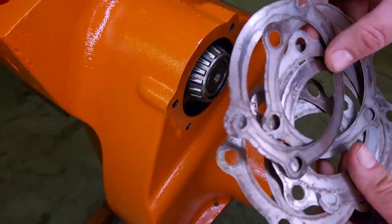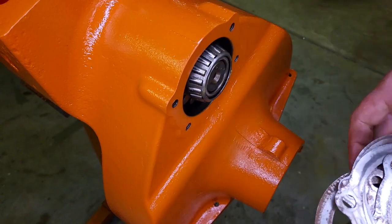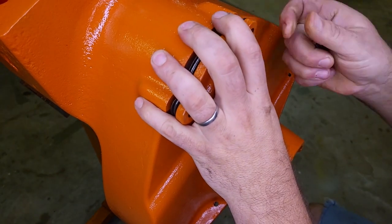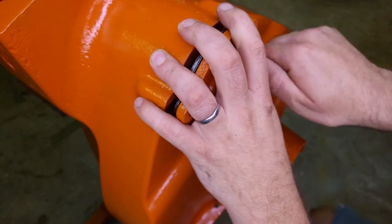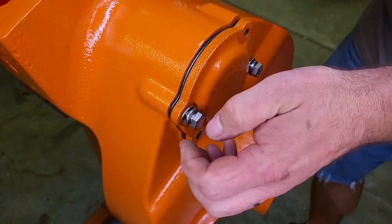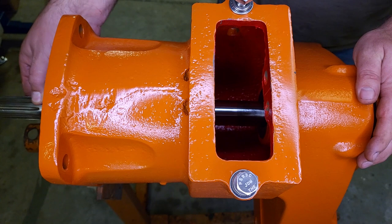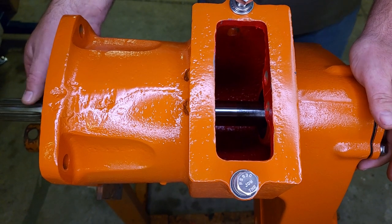Normally there's a piece of paper between each one of these shims. I don't have that - I'm going to use spray sealant like I did on the transmission shims. I'll put some copper spray sealant between each one and tighten it down. We've got five shims installed. I'm going to tighten this cap down and see if the shaft will still wiggle - see if we still have any end play. If we do, I will take away a shim; if we don't, I'm going to add a shim one at a time until I get a little bit of play and then subtract it. I'm going to do these by hand so I can feel how tight it is.